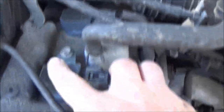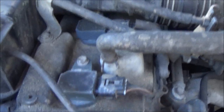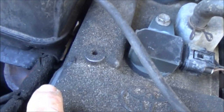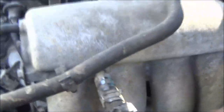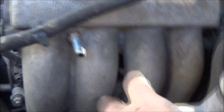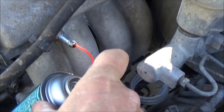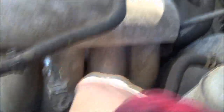Okay guys, what I've done is I pulled the number one coil pack out and stuck a screwdriver on it and scraped it right here to check it for spark. It's got spark. Then what I did was I pulled this line off — that's your intake or plenum if you will — and I've got some flammable stuff here. It's not starting fluid; I'm using brake cleaner. When I spray that in there and put this line back on, it'll start and shut off.